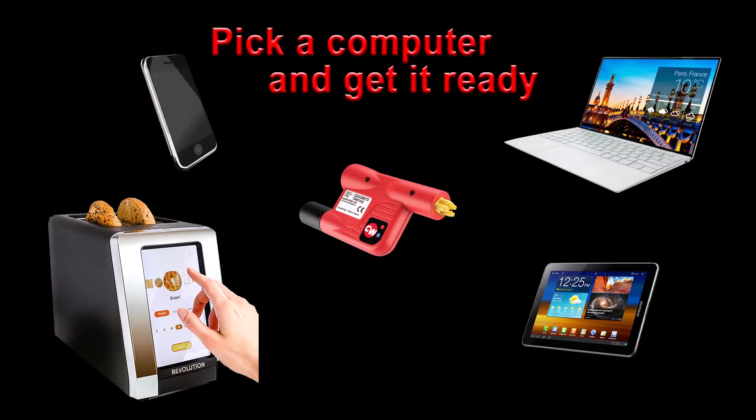Pick a computer and get it ready — laptop, tablet, phone, or toaster. If it's got Wi-Fi and a browser, it will probably work to program R-Net wheelchairs. The Wi-Fi dongle will time out if you're not prepared — no big deal, just means you have to start over. I got a Windows laptop ready by turning off the router. Windows won't look for the dongle's server on its Wi-Fi network if there's an internet connection.